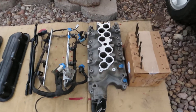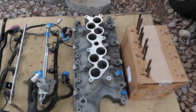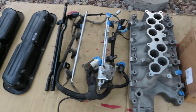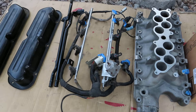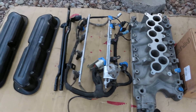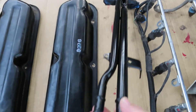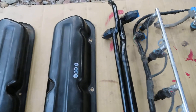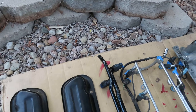I got the lower intake off, got it all cleaned up, and port matched the holes on the intake with the gasket and with the upper. Got the entire fuel rail and fuel injectors off so I can go ahead and get new O-rings on those before I put it back onto the intake. Got the heater pipe here — it was a little rusty on the ends. I went ahead and got all the corrosion off, repainted it, and sealed it up. Inside is in excellent condition, so the corrosion was only on where the hose clamps went on.